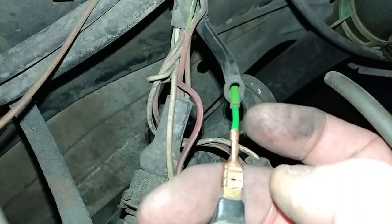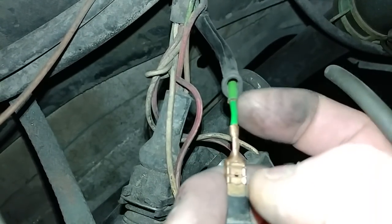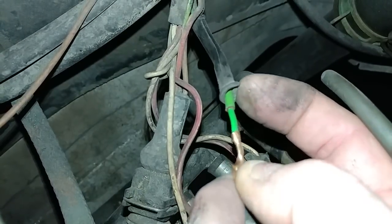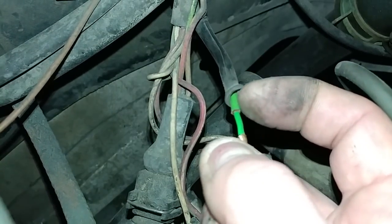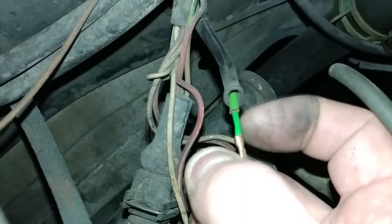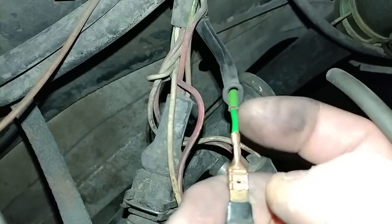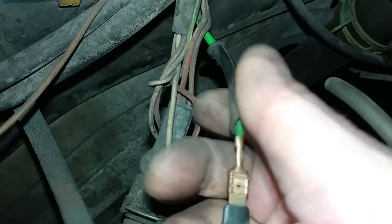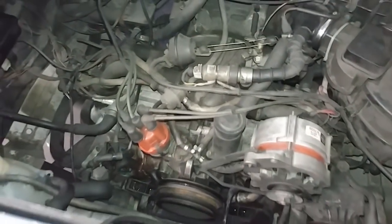So the first thing to do when you have running issues — black smoke at idle, rough running — push this connector back and check to see if those two wires are touching. If they are, you can cut the outer sheathing of the outer wire and move the shield wire so it doesn't touch the broken part. Or simply cut that wire and put a new connector on it for a clean connection. That's a lot of info to take in — you might have to watch this video a couple of times. Thanks for watching.